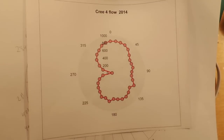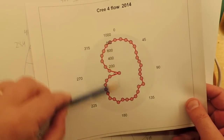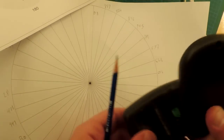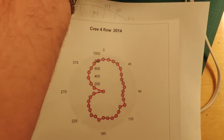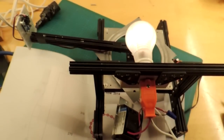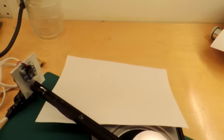Light distribution patterns around the axes. Some LED light bulbs are quite good at incandescent emulation, some are quite poor. The Cree bulb here is mostly a side-firing bulb, not so much the top. This is an entirely usable pattern and relatively consistent with other Cree products, though it doesn't fire downwards too much. I create this graph with a light meter analyzed at a ten-degree angle. I also notice a bit more intense light pattern at the top of the bulb. Using my new jig that measures every one-degree angle, the graph is a little noisier on the axes — you can see a pattern when white paper is placed on the bulb. So, not a perfect incandescent emulation by any means.